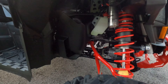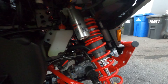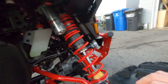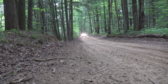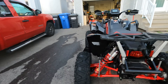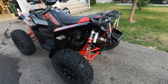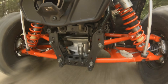Engine-wise, we have the parallel twin from the original Scrambler, which is a ProStar engine mated to a longitudinal transmission mated to a CVT. The CVT, I was told, was from the RZR family — I think it was the first gen Turbo S. The drivetrain is about 89 horsepower, mated to a huge differential in the back, also from the RZR family. The front differential unit is from another Turbo S. Otherwise, all heavy-duty components.